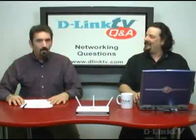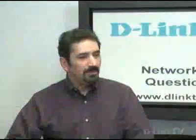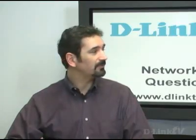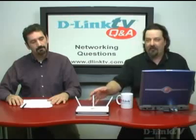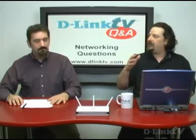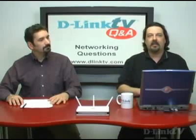Michael in Bethlehem, Pennsylvania has a PC with Windows XP and just added a second PC with Windows Vista and wants to go wireless. He wants to know if D-Link has a wireless router compatible with XP connected to his DSL and a PC with 802.11g with Vista. It doesn't depend on the operating system — you can plug your router into an XP system or a Vista system, configure it, and it will work in either case. The router is completely independent of whatever OS you're running. You can have Linux, Macintosh, media players — it's really OS independent.